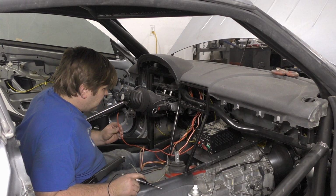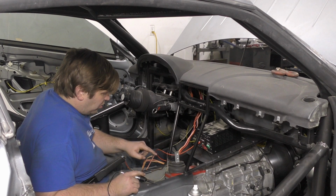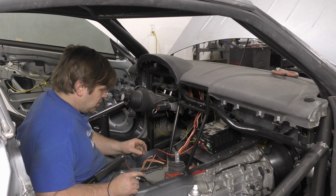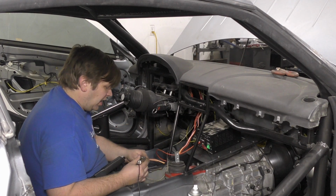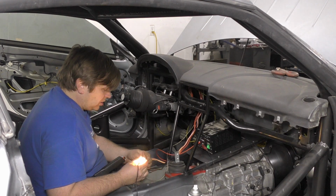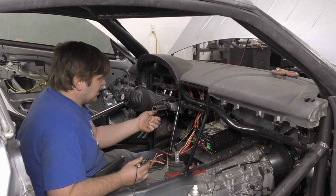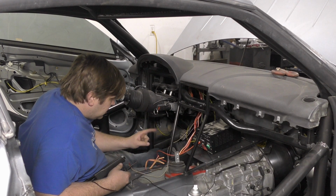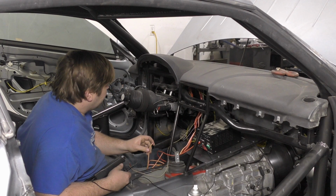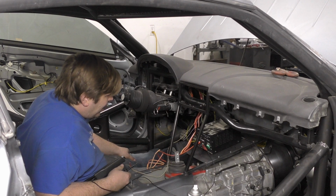That means I can remove one of these main power wires because I won't need that much power running through. Then we can choose whether we want any power on that middle section or if all that we want is an off and completely on. Which I am thinking that's what I want. It's just the off, completely on. So any of those would work. If we kill it back here, let's just use the yellow one. That way we can technically have on, off, and then this should be like a steering wheel lock. Alright, so I just need to keep my red wire, and we're going with the yellow wire here. Then I'll just have on and off, because the rest of it I really don't care. And that will be how it is.